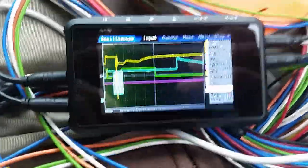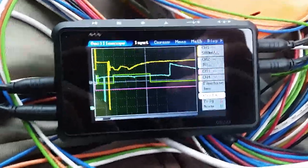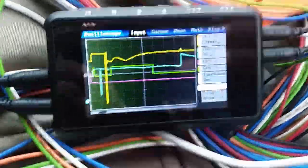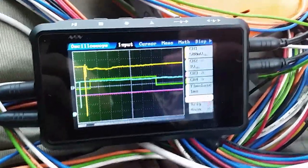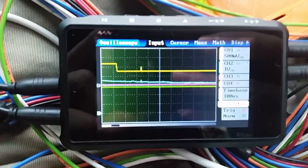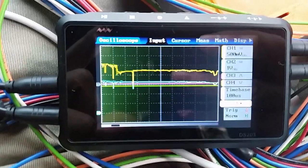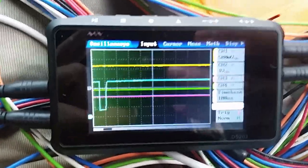We're now knocking. As you can see, there's a lot of that blue digital signal. Those events — the number of them appears to be proportional to the amount of knocking. The digital signal is very visible. What's happening on the analog side, we have no clue.